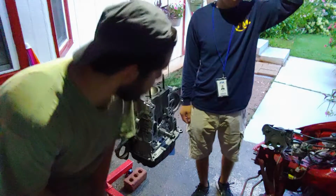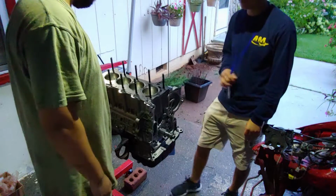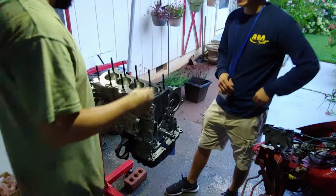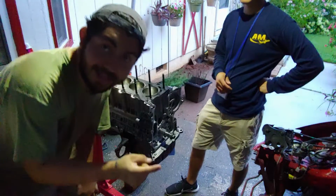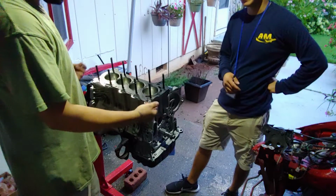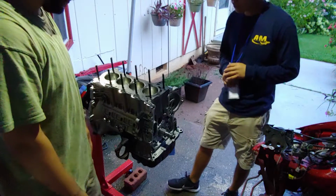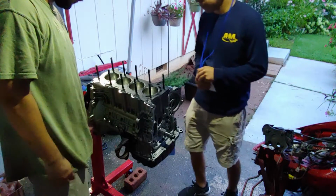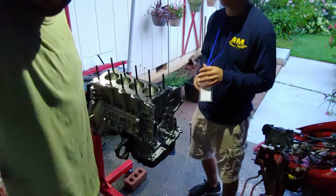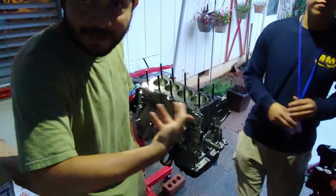All right, so the studs are on, the head gasket, the freaking head gasket is on, and we nudged all the bolts. The cylinders are lubed up with more than enough oil, I'm pretty sure. They're not overwhelmingly drenched with oil, but we're gonna pop the head on there now, and hope I did the bottom end right.